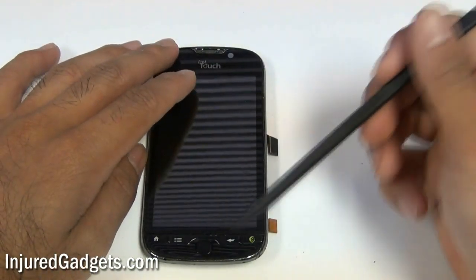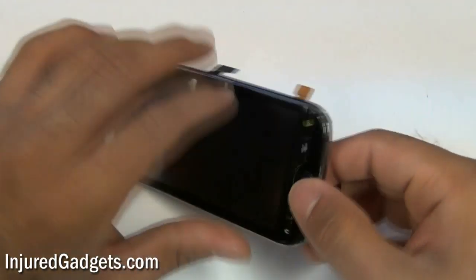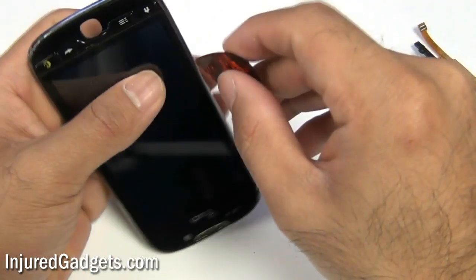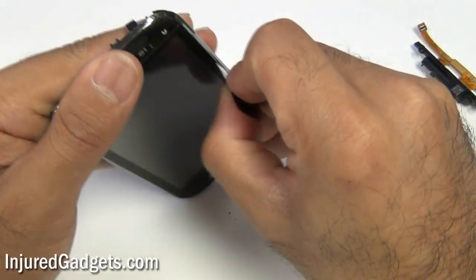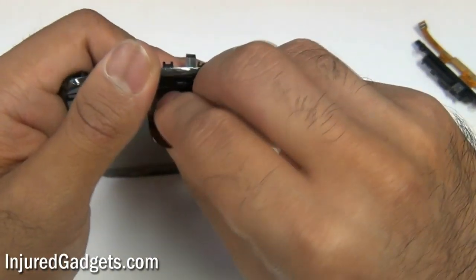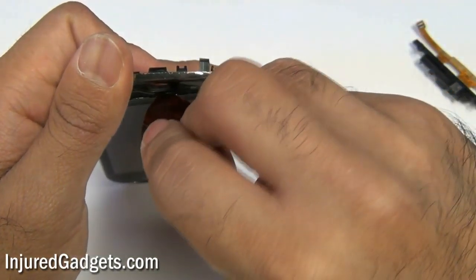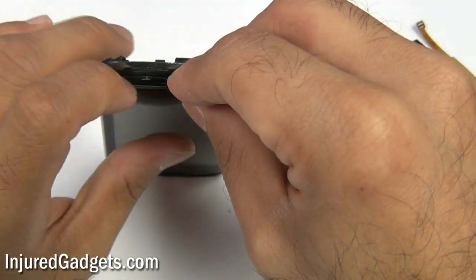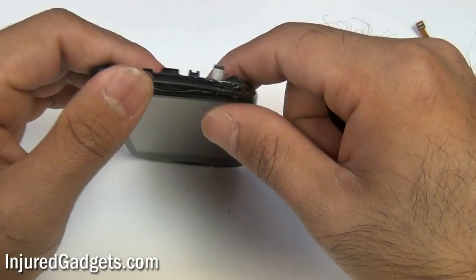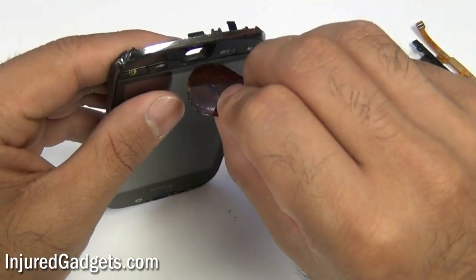At this point, you can apply heat with a hot air heat gun or a blow dryer to the top, right, left, and bottom of your phone. Sometimes that keypad flex pops out from behind the keys — that's fine, just push it to the side. Once adequate heat has been applied, you can use a safe open pry tool, guitar pick, or whatever to separate that screen from the LCD. There is adhesive there, so it might take a little prying to safely get it out. If it's giving you a hard time, just heat it up a little bit more and it should come out fairly easily.